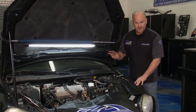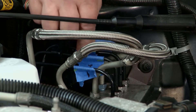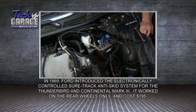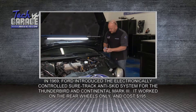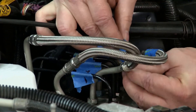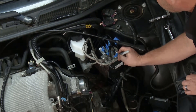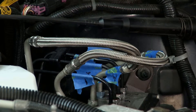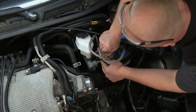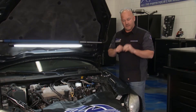I'm a half a step ahead of him — I was anticipating a problem. Before I loosen any bolts, I've labeled these lines. You don't want to cross anything up or you'll have big problems later on. You especially want to label the in and out lines from the master cylinder. I'm going to do that with just an A and B tag using a Sharpie. I'm marking one, two, three, and four — and then marking A and B right on the master cylinder. That way we've got a point of reference and we can't mess this up.